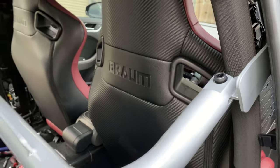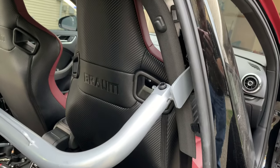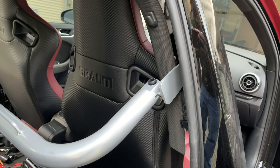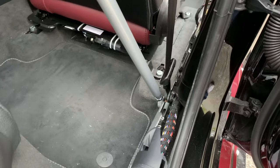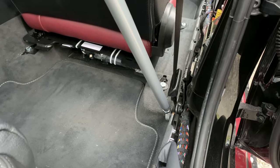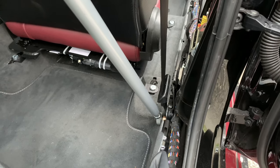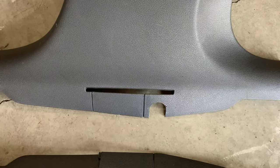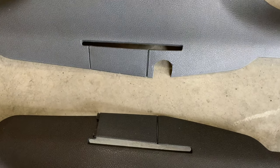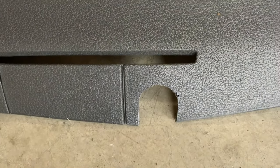It took a little bit of work, but that's where I'm at. Where the trim piece is, I'm going to have to use my trusty Dremel and cut a little chunk out so that bracket can fit there. I also need to cut a little chunk from the bottom, which I'll show you next — that will slide right over that piece, and that's why the spacer is there: to give wiggle room so the plastic trim piece can fit right over it. Here's part of that trim piece that I started to Dremel out. I'll lay them side by side so I can template off the original cut — it's not the prettiest, but no one's going to look down there.